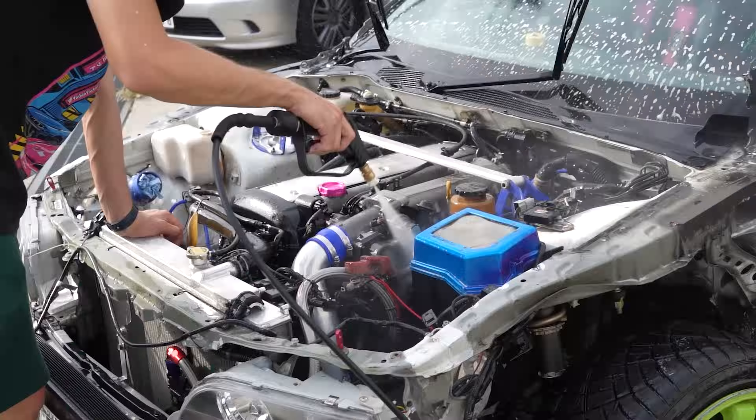Every single time I pull apart an engine I have a cart for that engine, because everything goes in its place in its order, gets marked, and I never want to mix anything up with other things going on. We pull down a lot of engines here and I don't want to get anything misplaced. Instead of having stuff on the floor, we can have everything from the engine on one of these carts, push it around - it's just so much easier. I'm going to look at this for a bit and figure out what to take off first. Looks like I just need to undo the oil feed, get the VVTi valve covers off, camshafts out - I'll probably just cut the timing belt. Just want to get this head off and see what we're dealing with.